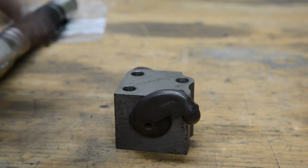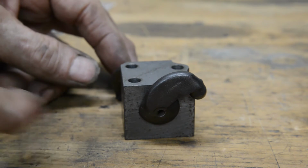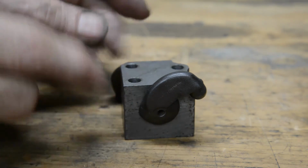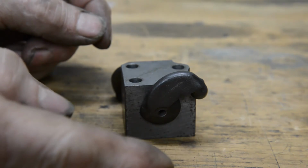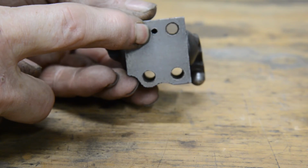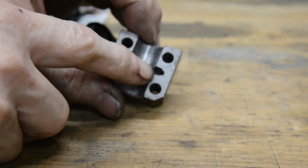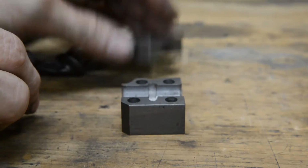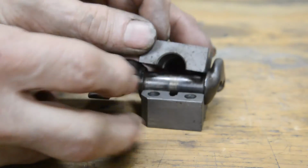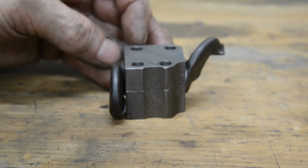I got a little bit ahead of myself there in the explanation. I didn't tell you how the rockers are lubricated, because normally what you see, like BSA's, Triumphs, all the rest, is there's a feed at the end, because this shaft is in the head. But what happens here is, you'll see when we go back to the head, the oil feed goes into the head on either side, and then it comes up through a hole and it goes through that hole there, which is another reason why you've got to have them that way up. Then comes up through that hole, goes into this sort of galley here, and then that just spreads out and lubricates that. Okay, the little cutaway there actually is where the head nut comes up.